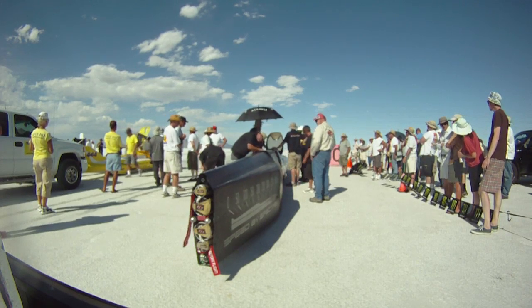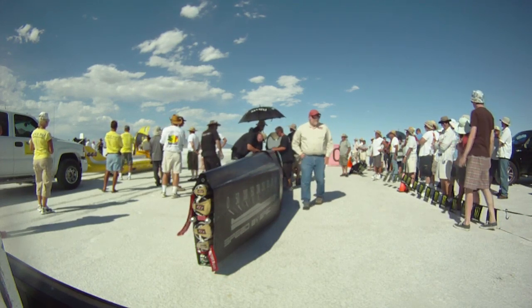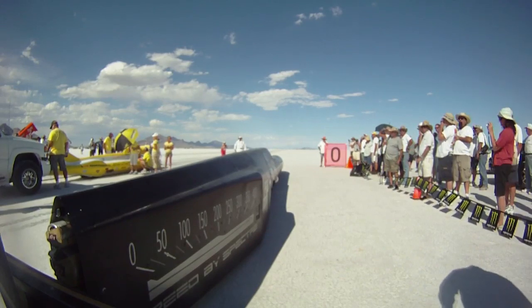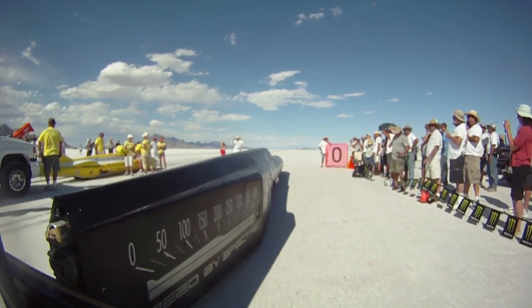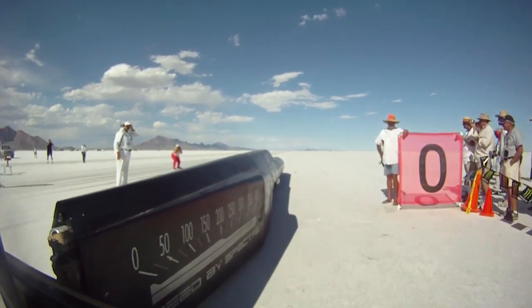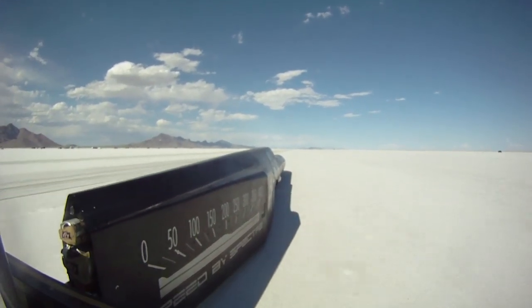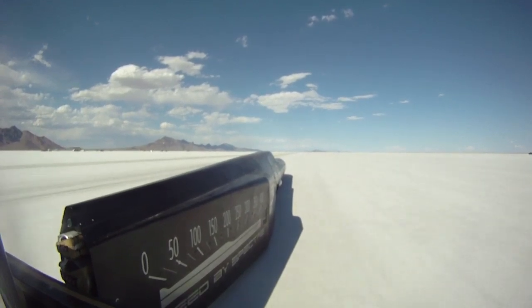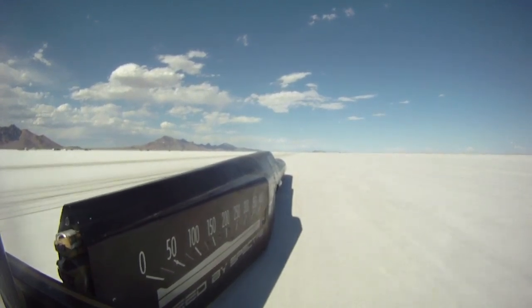The signal we have with the push truck — we have a stick shift push truck because our other push truck broke, so an automatic would push it easier — but we need to get this thing off the line around 55 miles an hour. To do that, we start the push truck in second gear, it's a diesel, then he goes to third, which means I get a bump, then he brings third gear up and short shifts third to fourth, and I get another bump like that.